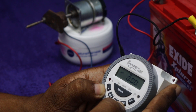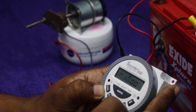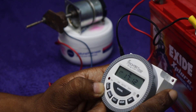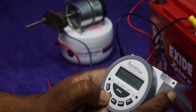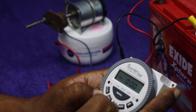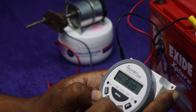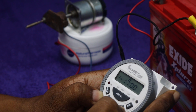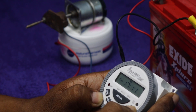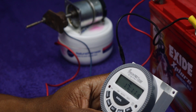Then select the day and the hours. I am setting here for 17 hours and 12 minutes, and again press timer so we will see that timer number one is off. Select the day, hours, and minutes — I am setting the off time to just one minute. So let's see how the timer turns on and off according to the settings.